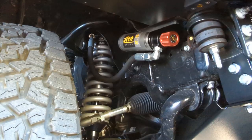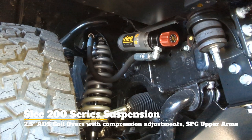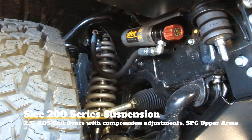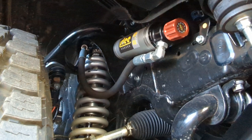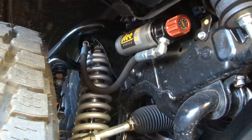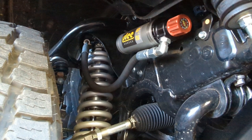One unique feature is we used this vehicle to showcase our new and upcoming suspension. Slee Off-Road works very closely with the guys at ADS Racing Shocks, and we have a whole line of Slee Off-Road branded shocks for all the Land Cruiser models. This is a true two-and-a-half-inch body coilover as well as a large two-and-a-half-inch reservoir, with compression adjusters — often referred to as clickers. We also paired this with the SPC upper control arms, one of our favorite arms because they offer so much adjustment. They allow more control of the alignment and tire fitment so we can fine-tune things for each vehicle individually.